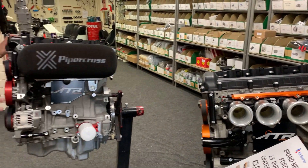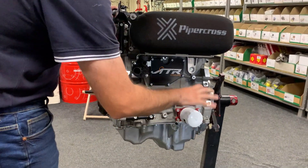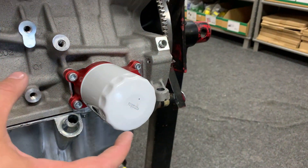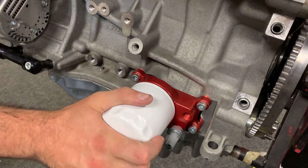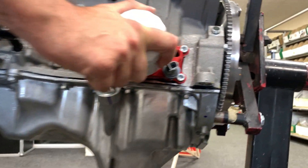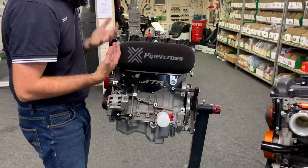This particular one here with all the red anodised parts will be going into an Escort Mk1. Some of the parts on it — we've got the oil filter housing. The standard Ford oil filter housing is quite a big unit that comes down and it's also got a heat exchange built in. It doesn't suit most applications and looks pretty untidy. So we've got a really nice billet one. It takes a standard screw-on filter, and we've got the pressure sensor for the warning light plus a second port where you can put your oil gauge in. There's also capacity within the housing to drill and tap a third one if you need it for certain motorsport applications.